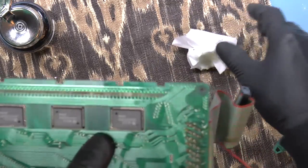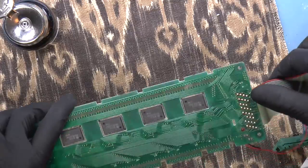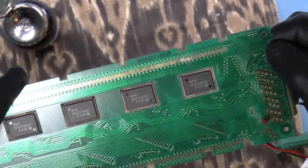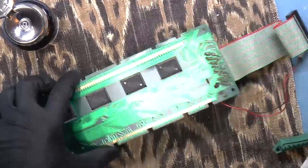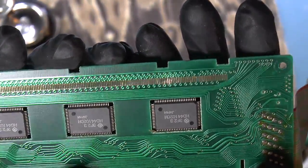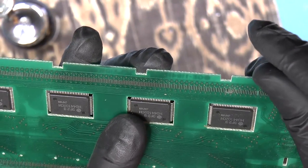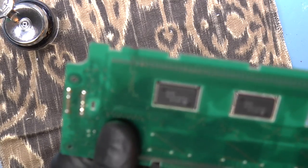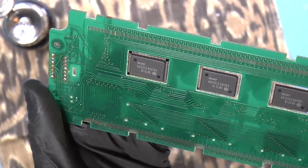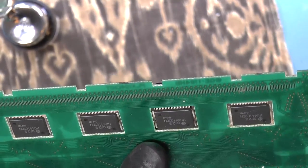Okay, I'm going to look at it under the microscope to see what exactly it is. Okay, so it was a little bit of a sticky kind of residue. Scraping at it did help somewhat. So now it looks a little better. It's not perfect. There's still what appears to be a little bit of corrosion on it, but I think we can call that done. So, yeah. And it did seem to cover just about 5 pins, actually, not 7. That would definitely be the source of the problem.